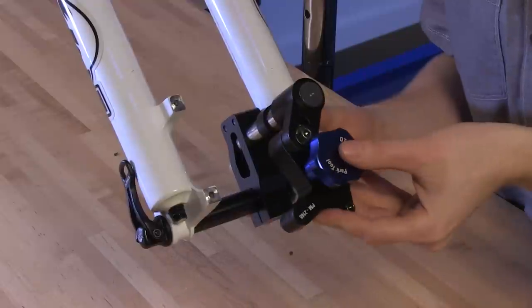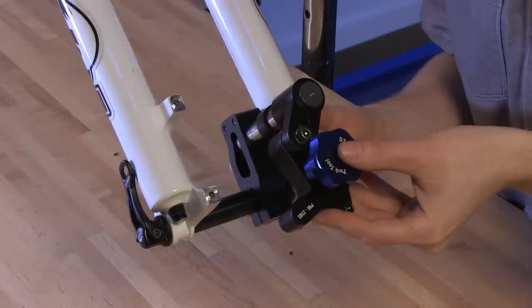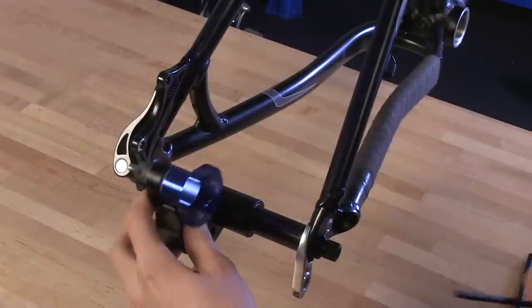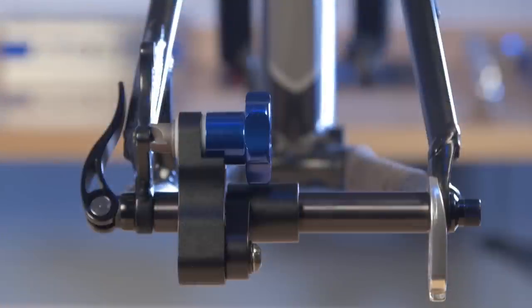In either situation, the post mounts will end up being the same height and the mounting surfaces will be correctly aligned and square to the rotor disc face. Remove the tool from the bike and clean up any chips or fluid. When facing IS mount systems, assemble the DT-5 configuration required. With IS mounts, you don't need to worry about setting the angle of the tool. The cutting procedure is the same as the post mount.